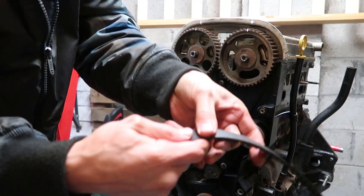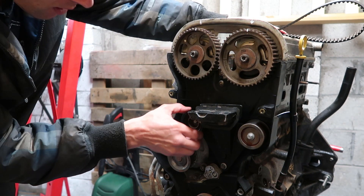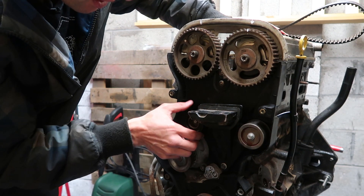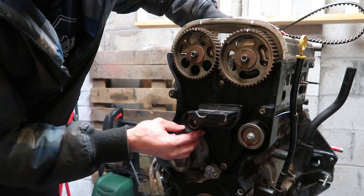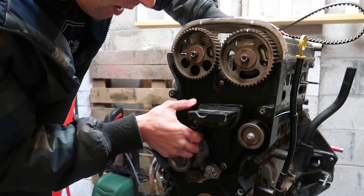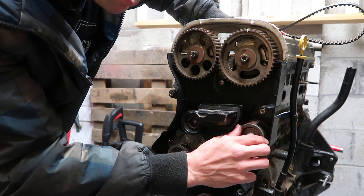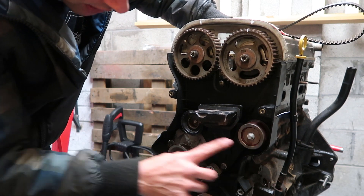It's just been sitting for a while — bit of surface rust from the pulleys. The exhaust side is a steel tensioner or idler and the inlet side is a plastic one, but you can get an upgrade where you run a steel one on each side, because the plastic one wears out quicker. A common upgrade is to run two steel idlers on each side.